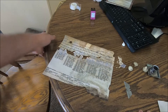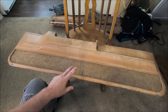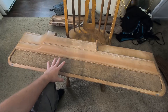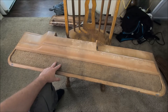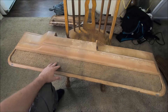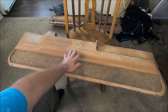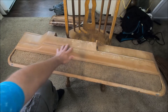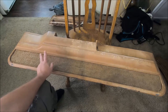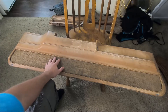We've got the most important codes. If the car were ever to become valuable, this will be with it now. For these panels, we aren't going to take the carpet off because it's glued on, and I'm worried if we try to take it off it's going to damage it more than if we just worked around it. So we're going to tape the carpet off, and then work these areas — we're either going to sand them down, build them up, or a combination of both, and clean everything. We want to get it kind of smooth. Then there's a special paint for these panels that we will apply — it's color matched. Then they will be ready to go.